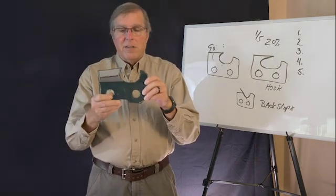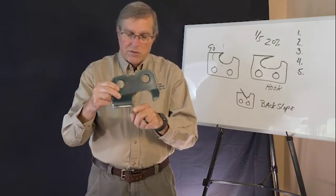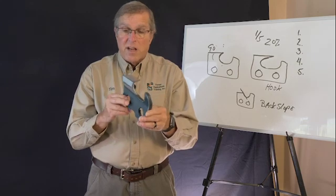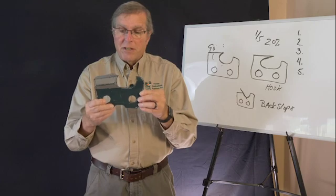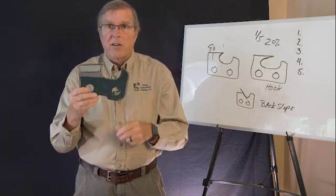But anyway, that's the 5 parts: the depth gauge, the point, the side, the top, and the chisel. And to be able to make sure that tooth is going to work as Mr. Cox's design did, we have to maintain it. We have to take care of all the damage, making sure the surfaces are great. So we'll spend a little bit of time on that. I want to explain it on the actual saw.